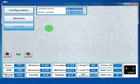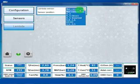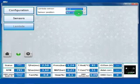Here we have the lambda sensor selection. We can connect the lambda sensor with the proper wire, a purple wire. Now in this car the front one is connected. Front is the pre-catalyst and rear is the post-catalyst. So this one is after the catalyst and this is before. Here you can now see the voltage of the signal of the lambda sensor.